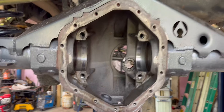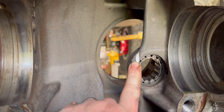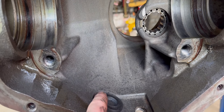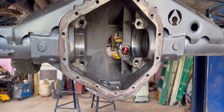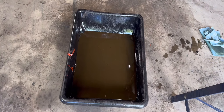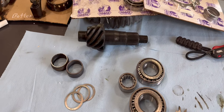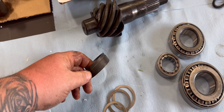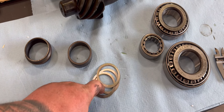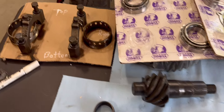Got this carrier emptied out — you can see where the ring gear was hitting for whatever reason, and this magnet was covered in shavings. It looks fresh but I'm not sure if it's from putting the yoke on. Here's the new pinion getting ready to have bearings pressed onto it, the old crush sleeve, and a new crush sleeve eliminator. I'm going to measure these shims and make up the difference, then add a few thousandths.